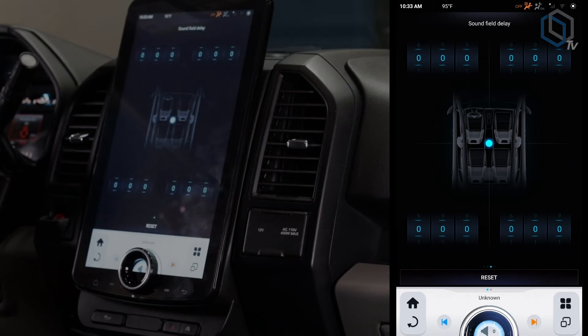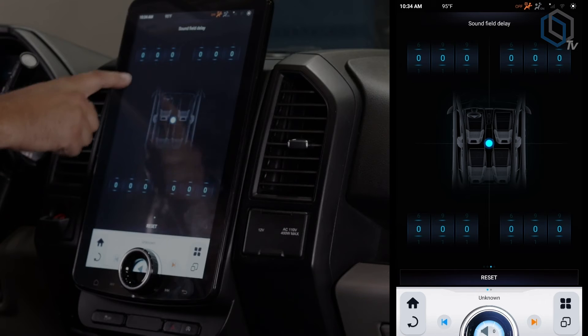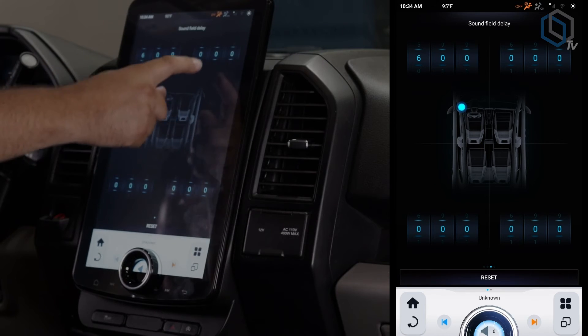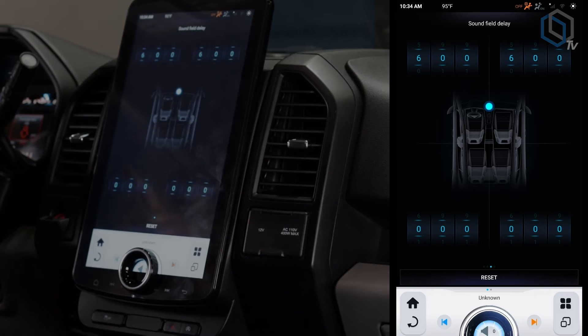What time alignment does is delay a speaker so that every speaker hits its peak at your ears at the same time. What's cool about this one is rather than measuring and doing all the math — like a lot of DSPs require — these dials up on top let you adjust it directly. If I want the stage set to front middle, I can take the first two numbers and set them at six, and you can see that little blue dial moving to where I want it.